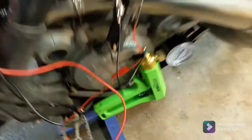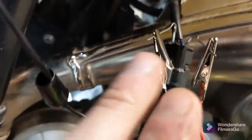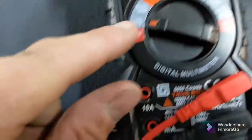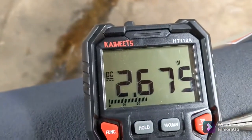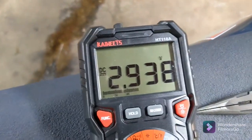Watch what happens when I plug this little air pressure gauge on. You can see it's plugged on there — this is a cheap Amazon jobber, I probably should have spent money on a better one, but I didn't. So we've got our clips going to the voltmeter. I have it set — millivolts is too low. We're at zero reading, no pressure yet, and we're still at 2.675. Now watch when I pump this up to, say, 5 PSI. There you go — now it's jumped up to 2.938.